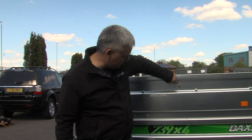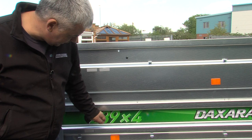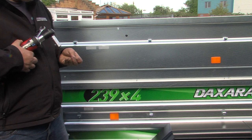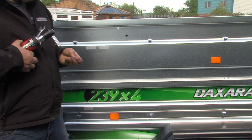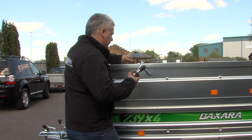The first thing we need to do is prepare the panels. This is going on extension panels and to prepare the trailer you need to take the higher front grommet out. If you're fitting it to the trailer it would be this grommet here, and you need an M8 bolt with two large washers and you need to clamp the panel leaving a thread sticking into the trailer.